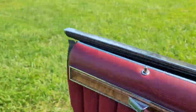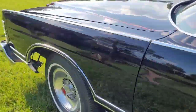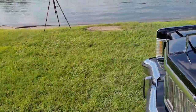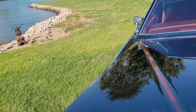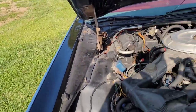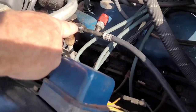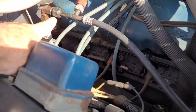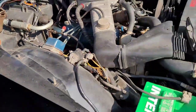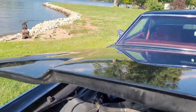The air conditioner worked all those years up until just a few years ago when it stopped blowing cold — it still had R12. I took it into the high school auto mechanic shop, where I know the teacher. I had already put some dye in it, and under the black light it showed up leaking right at this fitting. We put a new O-ring in it, he sucked it down, it was holding vacuum, and it's been in there for over a year now still blowing ice cold.